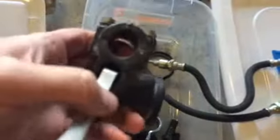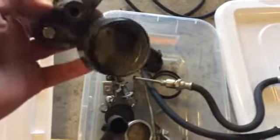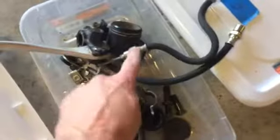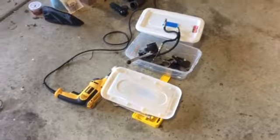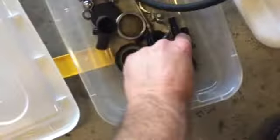I also looked at my master cylinder — I can't even see the piston in there, it's so far down. A master cylinder rebuild kit is about 30 to 35 bucks, but I can buy a reproduction master cylinder that includes the handle and everything for 55 dollars. Since I already bought a reproduction kill switch, I think I'm just going to replace that whole lever assembly with the reproduction master cylinder rather than rebuild it.